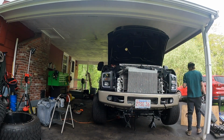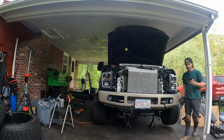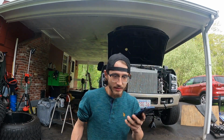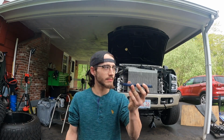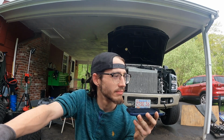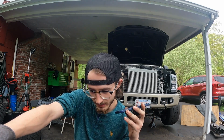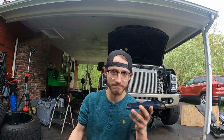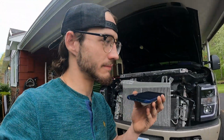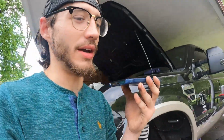Yeah, everybody's got an opinion. They're all internet warriors, they all know what's the best. So, yeah. The factory Cummins torque converter was 1,700 to 1,800. The Ford one was about 18 to 19, so you're talking a difference of 200 RPMs. Yeah, exactly. So it's really not that much. And a low stall is like 1,600, so it's not even that much different anyway. Yeah, so it's not that much lower. And guys think a little bit lower is better, so a lot lower must be way better. Yeah, it's going to be fast. Then it starts dragging you through stop signs.